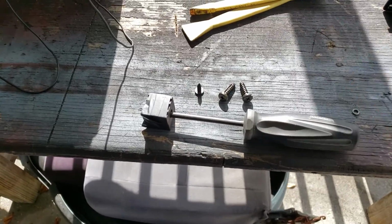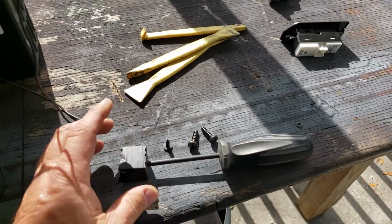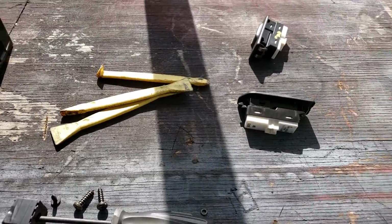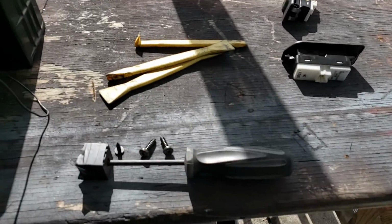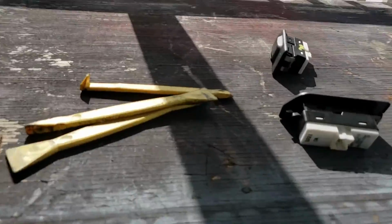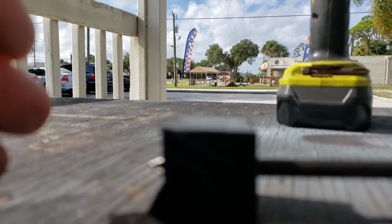One more little tip I got for you guys. This is a little Craftsman magnetizer. A couple of people make magnetizer demagnetizers. You'll almost always find it on my number two Phillips head or on the Phillips head bit that goes in my impact driver. They usually just leave it sit on there so that my tips are always magnetized. This works by just aligning the electrons inside the piece of steel. So basically, by sliding it back and forth, you're just aligning the electrons, and you do that a couple of times, and everything is good.